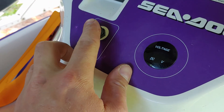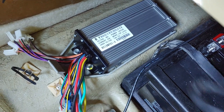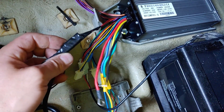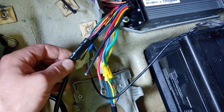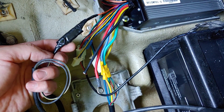Next step is to wire the kill switch as our ignition on/off switch. I went ahead and took the wires for that, ran them right down to the key switch — pretty straightforward. They do have male and female spade connectors; however, even though they're sealed, I went ahead and used tape to make sure nothing was going inside them.